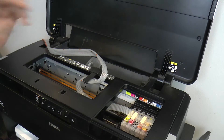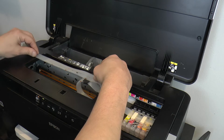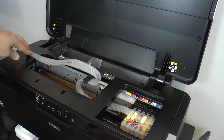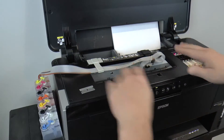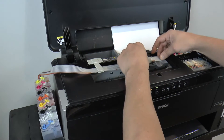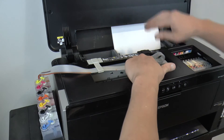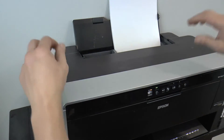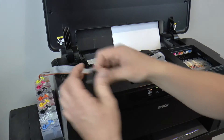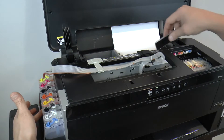The next step is to put the other clip in to hold the tubes in place, then fire up the computer and do some test prints to get the air out of all the lines and flowing into the cartridges. I've got it all set up the way I like it — put another clip in, added a little rubber band with not too much tension to hold things directly in place so the door closes nicely with no crimping. I'm just going to put some velcro on the ink reservoir over here, and then we're going to fire off some test prints to get the ink flowing.